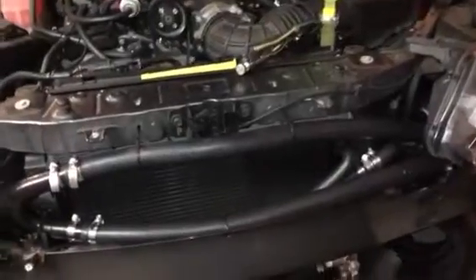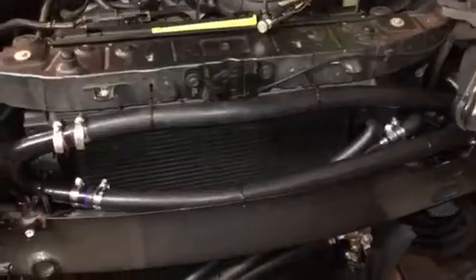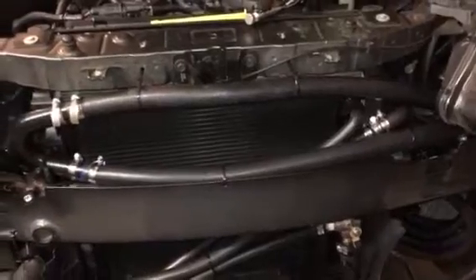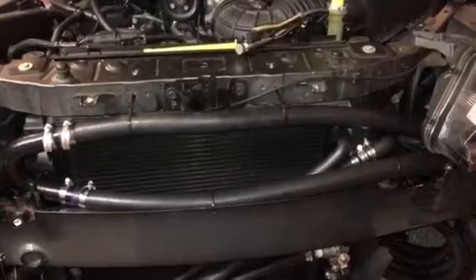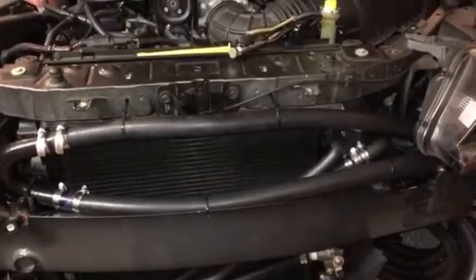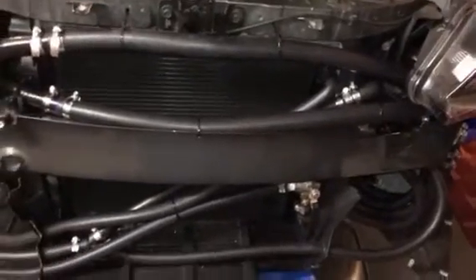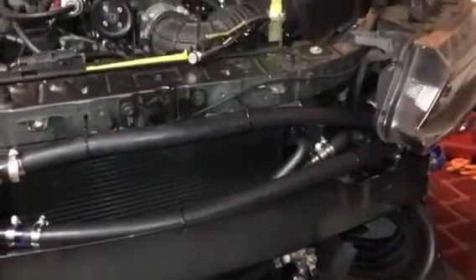In the middle of the instruction manual I mention that if you want to lower your IATs even more, you might consider completely removing the front-mount Edelbrock heat exchanger and running some coiled-up hose in there. The downside of that is you've got to run your air conditioning all the time, because if you turn off the AC or have an AC failure, you would not be cooling your IATs through the typical front mount, resulting in very high IATs.